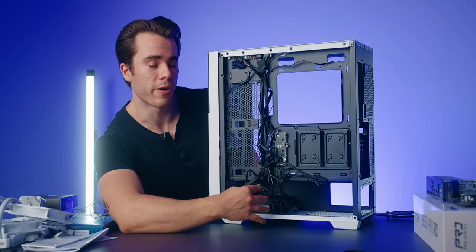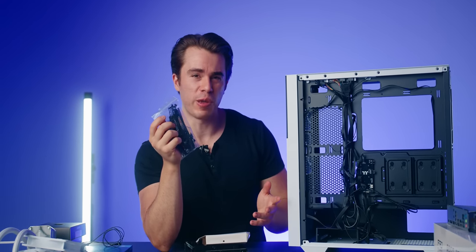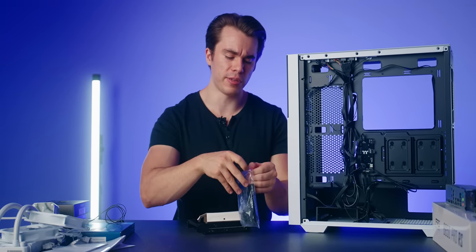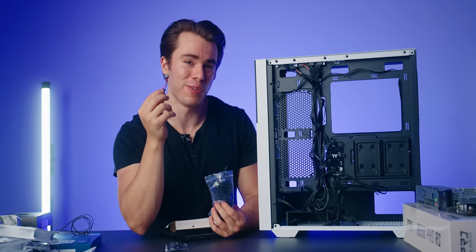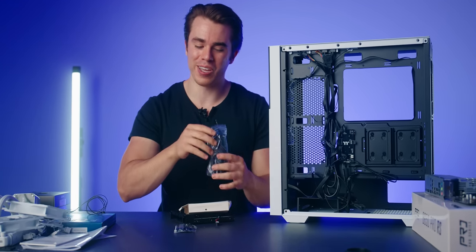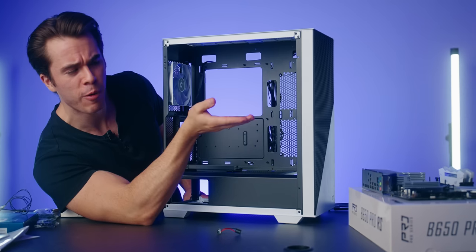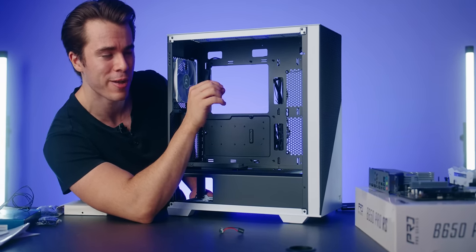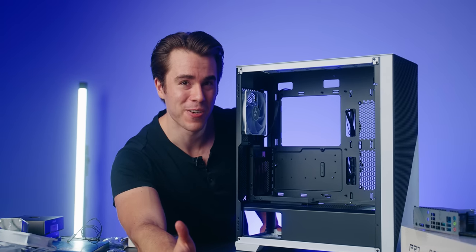Let's turn around the PC case — there are a few things we need from the back. Here we have some spare PCI covers, zip ties, and most importantly, all the screws we'll need to install everything inside the case. We're also given a BIOS speaker, which we'll plug into the motherboard — every time the PC successfully boots it'll give an affirming beep, or tell us what the problem is if it doesn't work. The standoffs inside this ATX mid-tower are already pre-installed for our ATX motherboard.